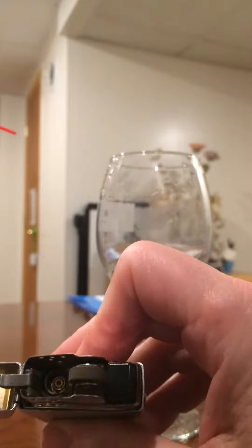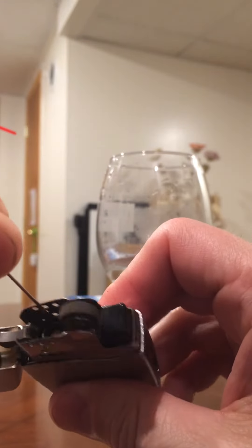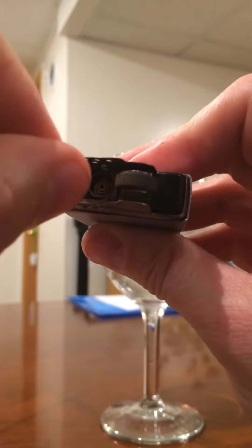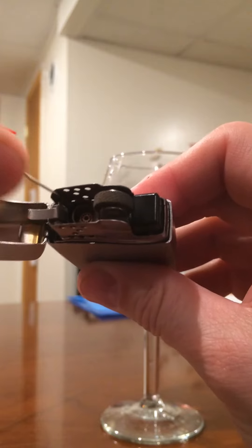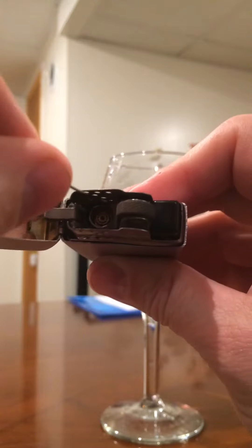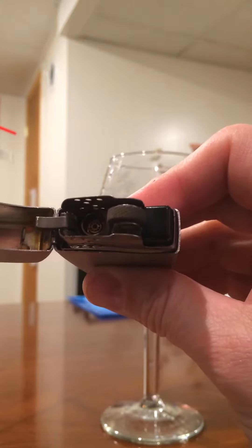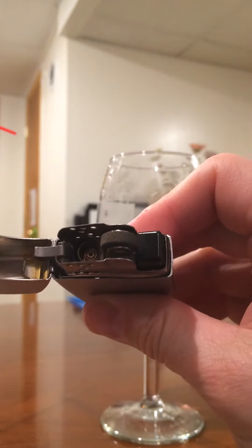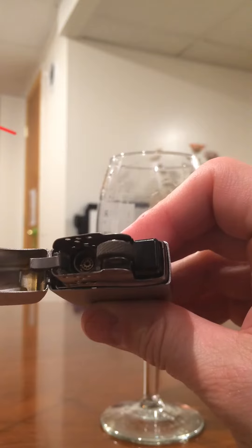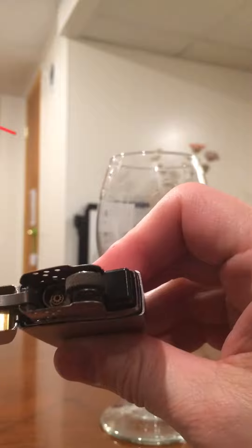But really the biggest thing you have to do is take a pin or a needle and go around this edge here, and scrape all that out, then clean each of the individual holes where your flame comes out. One of the things you can do is flush it with rubbing alcohol — make sure that evaporates before you try and light it. That can help flush it out.